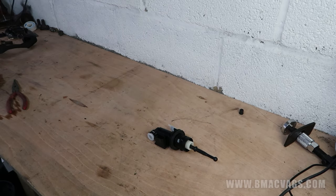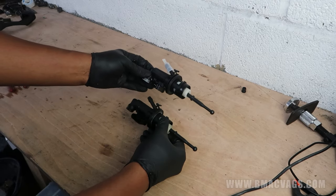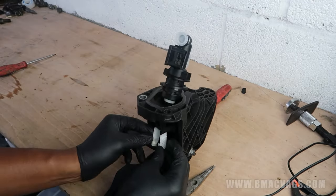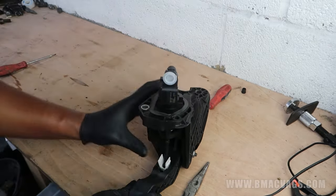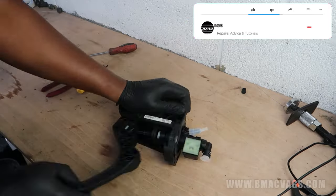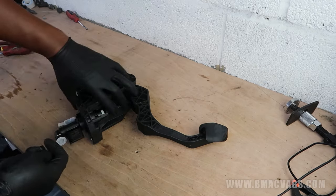Here's the new one - it's basically a reversal of what we did. Just check that it's the right one because there are a couple of different ones - line it up, make sure it's the right length and the hose comes out the right place, because it's such a difficult job you don't want to do it twice. Get it around the joint, push it into the space, squeeze it up, twist and lock it clockwise. Make sure the little locating clip on the side is seated correctly. When you put it back on, remember to bleed everything and sort it all out.